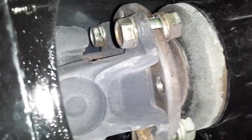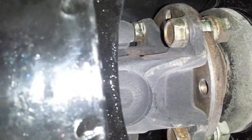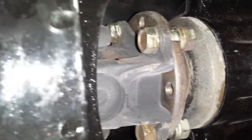Would I do this if I was building a 700 horsepower build? No, but I would bet that this combination is stronger than the stock Mark II U-joints made it to the stock flange, so the 400 wheel horsepower that would be the most this car will ever see, I think that'll be just fine.